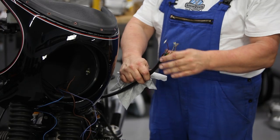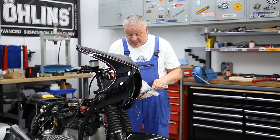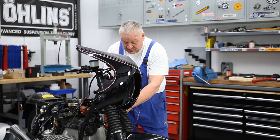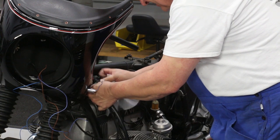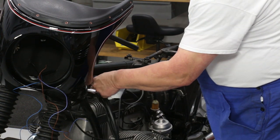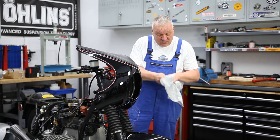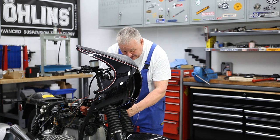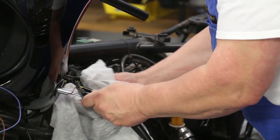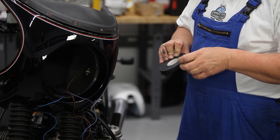We've successfully combined both harnesses into this one in the new flexible conduit, and I just need to clean up this junction here and put some new tape on it. First I'll get rid of the old tape that has lost its adhesion, down to where it starts to be good again. This stuff can get kind of grimy, so I'm going to get some of that grime off because the tape will stick better.